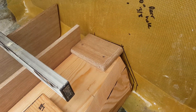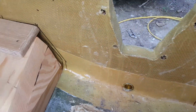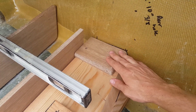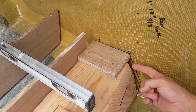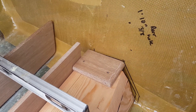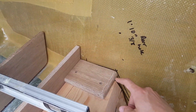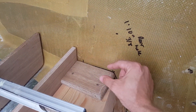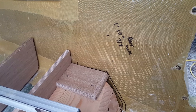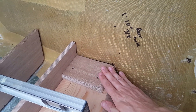Another little thing I've done — I did this on my last build too — is I stuck these two little plates on top. They're two little sheets of plywood. The reason I always end up having to do that is because this edge right here, specifically the gap here, is always tough to capture. You can measure and measure and the likelihood that you're going to get it perfectly is not very likely. This gap that was back here tends to be a little too thick for the peanut butter to take hold. So I put this plate, and also as the water runs down it gives it more strength so over time you don't have any issues.